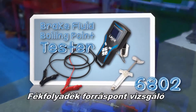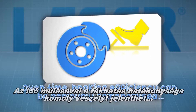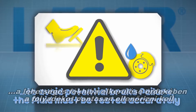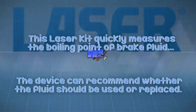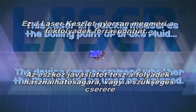Non-silicon based brake fluids absorb moisture over their service life, and braking efficiency and safety is greatly reduced. As the level of moisture in the brake fluid increases, the boiling point gets lower, and the fluid cannot safely perform its vital function. Therefore brake fluid should be tested, and the most efficient and accurate method of testing brake fluid is to actually measure its boiling point.